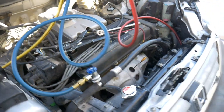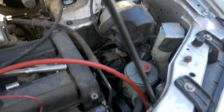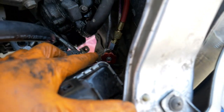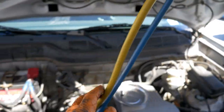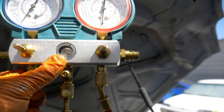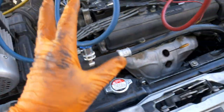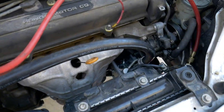I've been vacuuming the system for probably the last 25 to 30 minutes. Bumper's back on, power steering, cruise control — everything is reinstalled. I closed off both ports so there's no air escaping back through the pump, and I'm going to leave it and check it in about 20 to 30 minutes to make sure it's holding. Then as long as it looks okay, we are going to attempt to add the R134A and see if it's working correctly.